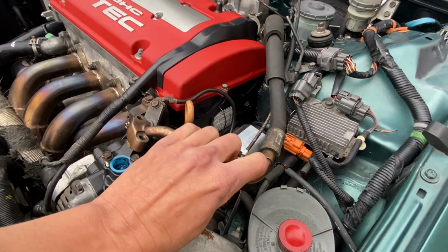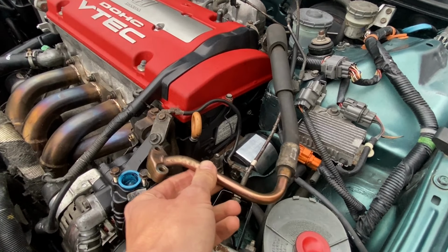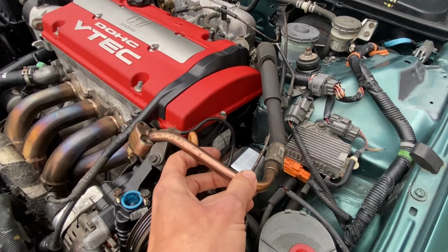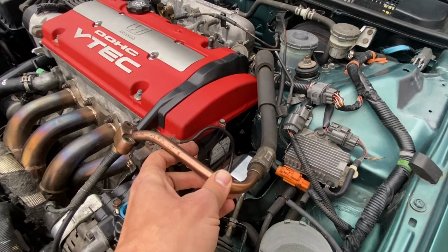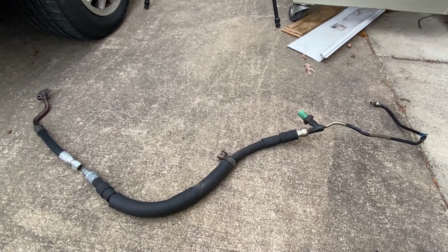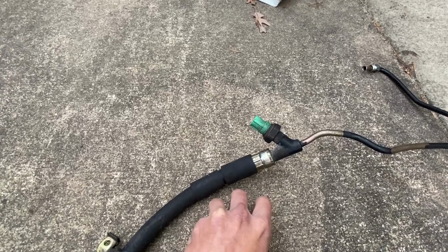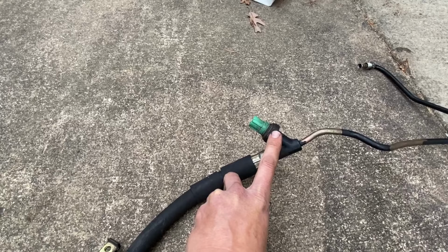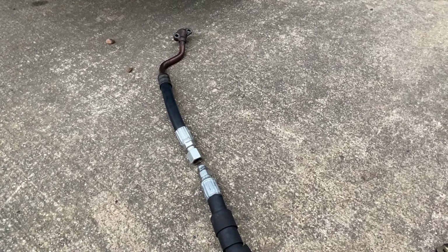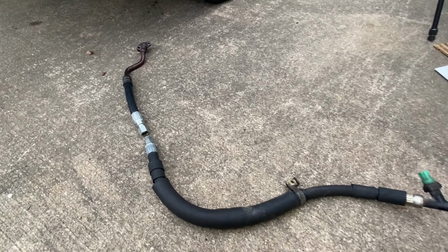So this is the CB9 power steering hose line, and the head is obviously different than that of the H22. So we'll go ahead, remove this CB9 high pressure line right here, disconnect it from the steering box, and then we're gonna reinstall the hose that we originally had on there with the modified coupler from Napa Auto Parts. This has got the correct orientation for the sensor right here. And we're just gonna bleed the system out thoroughly and cross our fingers it was just air in the system. So we'll see what kind of end result we have.